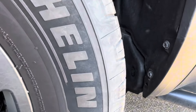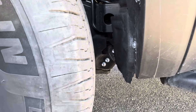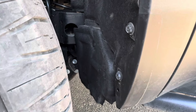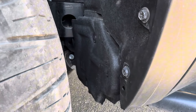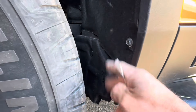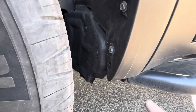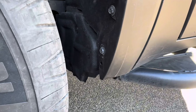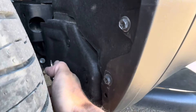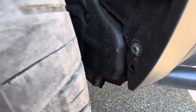This is what we're looking at — we are going after this guy right here. I already removed my mud flaps when I did the wrap, but as you can see, not a lot of room there. On my Tacoma I had the pleasure of paying $180 for a body mount chop to take care of this. On the Land Cruiser we just need to do a few things: one, remove the front mud flap; two, remove these three — there's one, two, and three way back here.